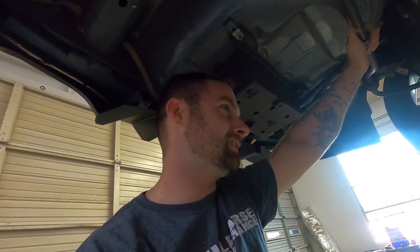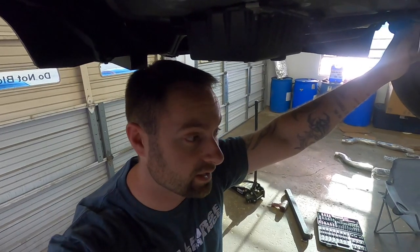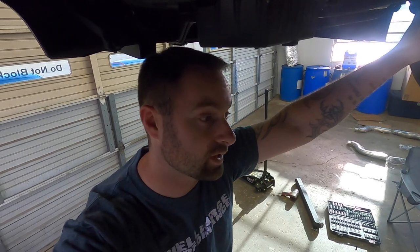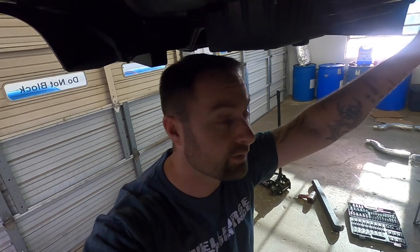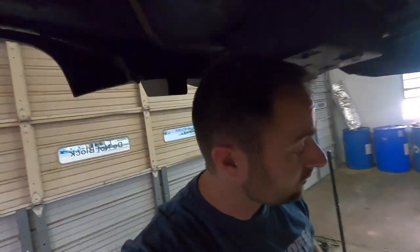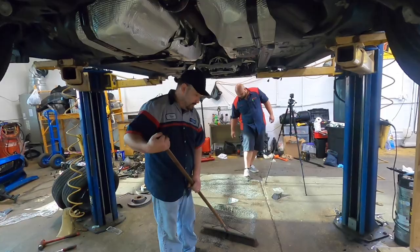I've seen cars go 9.30s on stock axles. The biggest thing holding everybody back is tires. Dude, it's a nationwide back order for 305/45/17 ET Street R. If there's an alternative for a 17 by 10 drag radial besides ET Street R that will hold this power, let me know, because I need some too. I'm not going to be able to put it on a two-step and launch. Yeah, well, I am. We'll go two-step.